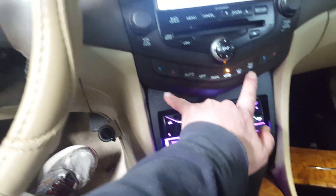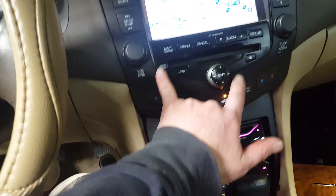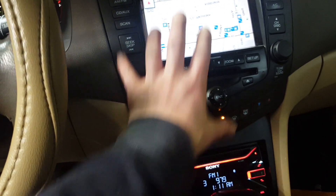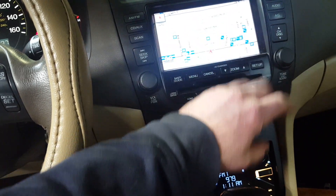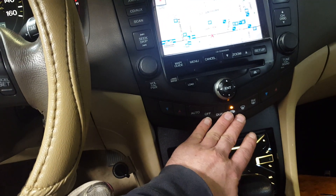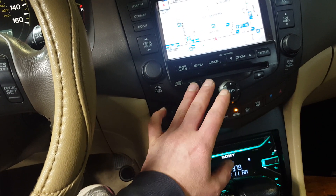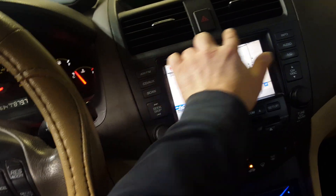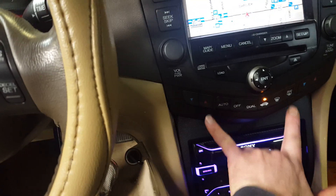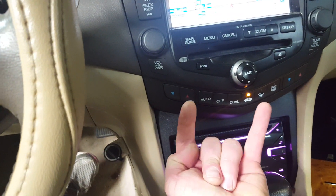There is this panel here that I haven't had to take off on the regular radios, but since this one had the bigger navigation unit I had to pull this out to access the rear plug and the antenna wire. I've added FM modulators on these vehicles too where I can get in and unplug the FM wire and grab power and ground off that harness. But with this one I had to pull this panel — it kind of just comes up and out. There are screws along the top, and underneath the back side there are a couple of 8mm and Phillips screws that hold it up from behind, then just pull straight out.